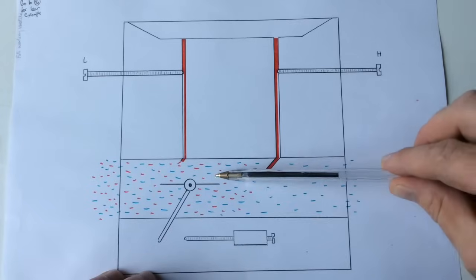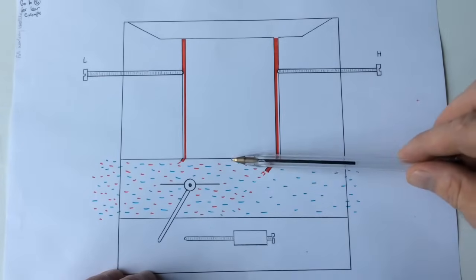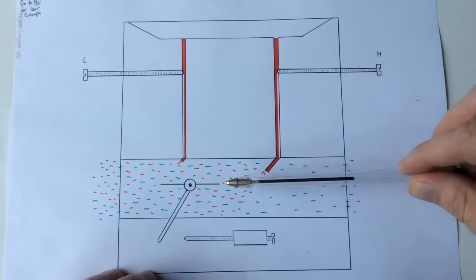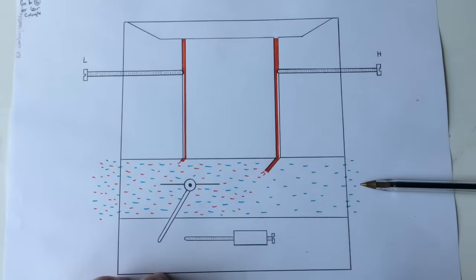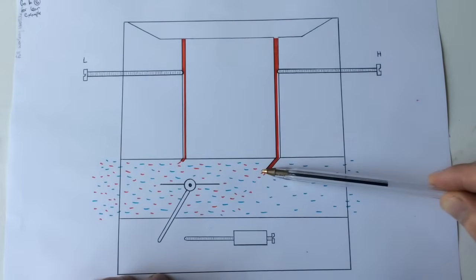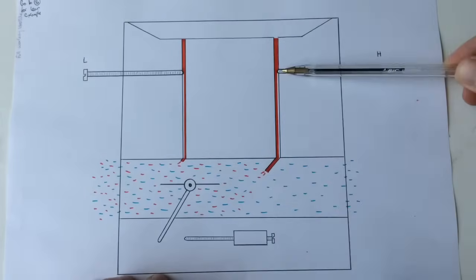That allows more to be integrated in with the air there so that it can atomize with the air - that's what the venturi is for, to atomize and mix with air inside the venturi here. So I've got this throttle wide open and working at full speed. Air is rushing through and as it rushes through it draws this fuel out.